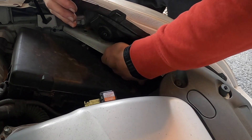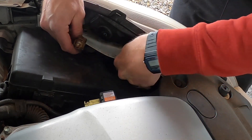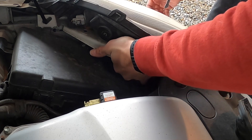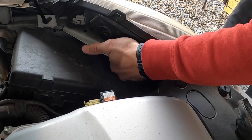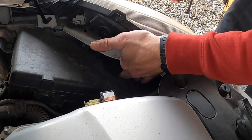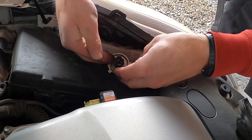There's not much room to get your hand in here. Got the plug off and boot off. There's this little metal clip — just feel for the clip. None of the videos really show you this clip because it's really hard to see. There's a little tab on the clip and you just push it down towards it and it releases.